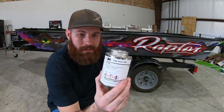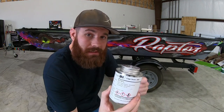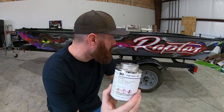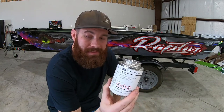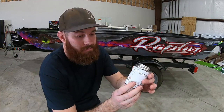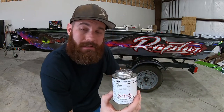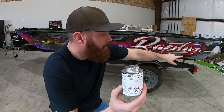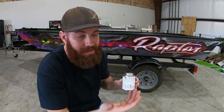Last but not least, did all the post heating — got everything nice and hot, about 150 to 180 degrees with the torch. You can get a little IR digital thermometer for that, but I've been doing this long enough that I know by feel. This edge sealer is what we're going to use for the final step. We're just going to go along the entire outside perimeter and glob this stuff on really, really generously. You can get away with a silicone caulking along the top rail, but along the bottom and the sides you definitely want to use this edge sealer — it's what locks your wrap in and prevents it from peeling up, combined with the tape primer underneath.